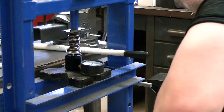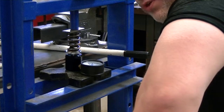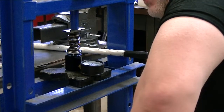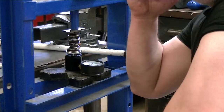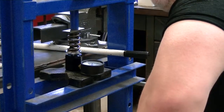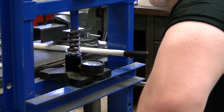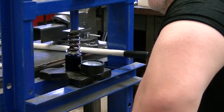And I think actually it was the second video, and if I remember right, I was testing the AFR springs, the ones that actually came off of these heads. And the numbers were off, but the heads and the springs had 60, 70 runs on them, so I kind of expected them to be off. I thought maybe one or two valves at some point bounced on the seat a bunch of times, heated up, and weakened those springs. So the variation was somewhat expected.